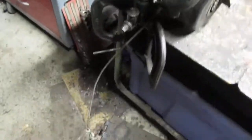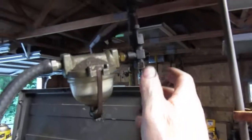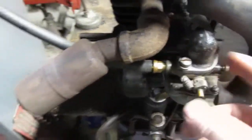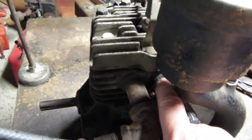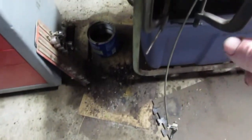Other than that, that's about it on this motor. Let me turn my gas off. This is my homemade setup — I've got a David Bradley tank up on a stand with a magnet on my metal table, and I just hook it up to get them running to test them out. You can even start them without the carburetor by spraying a little gas or starting fluid up inside. I've got a throttle cable hooked up because without one the thing runs wide open.